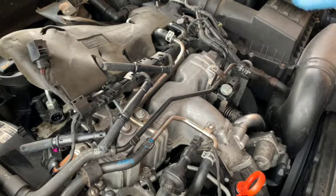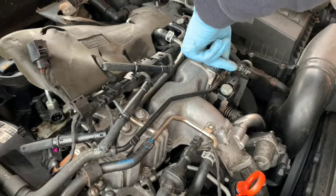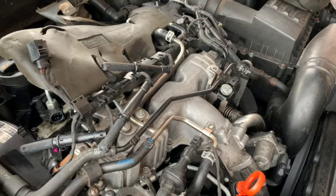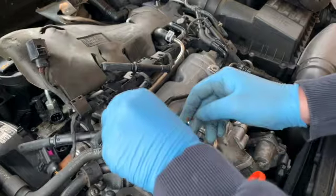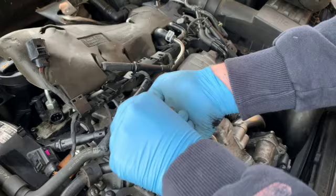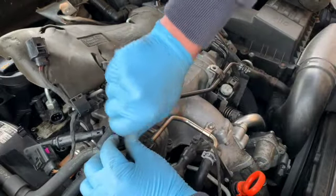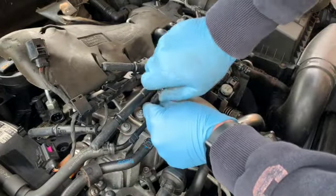Get them tweaked down. I did a bit of research before I started and it said this should be at 18 Newton metres, so I'm going to see what that feels like on the torque wrench. But I don't always believe everything I find on the internet - if it feels too tight I won't do it. Like I said before, don't use any impact gun or air gun or anything on these because there's not much thread to play with and it's all aluminium, so do it by hand.